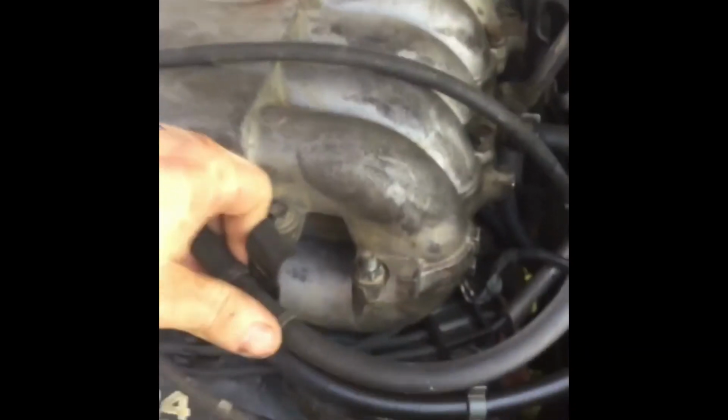It's kind of hard to see. It's really sunny out today, but it's dripping down right there, and you can see it's dripping down onto the manifold. So here are the gaskets, and it comes with spark plug tube seals. So you gotta remove the air boot. The intake manifold's gonna have to come off. All these, the linkages, and all these vacuum hoses.